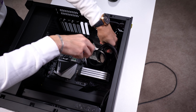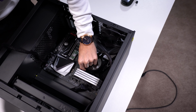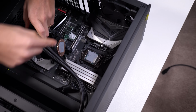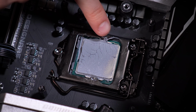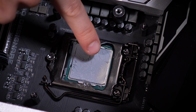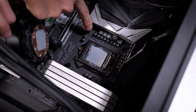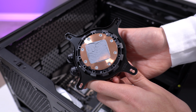Now what I'm gonna do is remove the AIO, just using a screwdriver here, it's a little faster. Get these 3 thumb screws off, and we're gonna see how this thermal paste was spread over the IHS. I'm gonna pull straight up, and that explains a lot. So Kyle, if you pull in here, you can see that we actually had a little more thermal paste than we needed, pretty much everywhere across the IHS except for the top right. The reason why the top right went fairly uncovered is because the mounting pressure was greatest over in this corner. So that effectively pushed all of this thermal paste down to the bottom left. And remember, the bottom left is where we didn't have one of these thumb screws secured. So that makes sense.